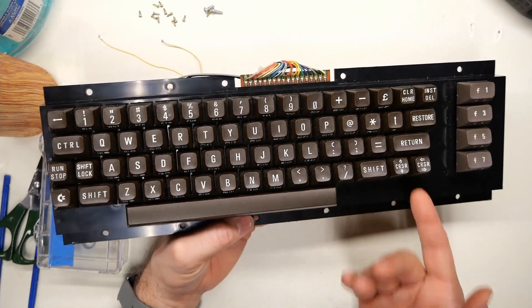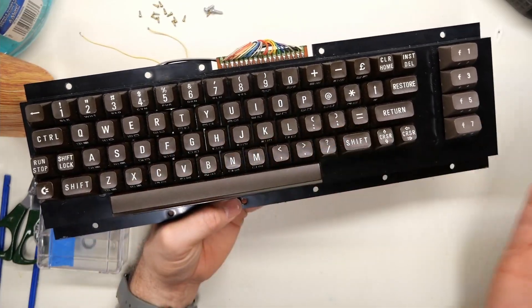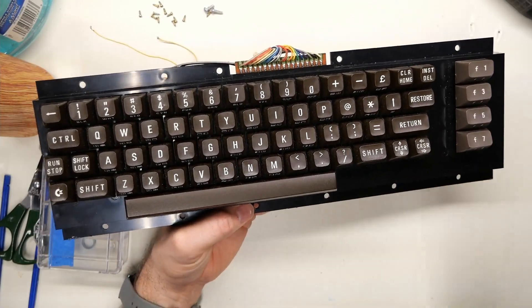There you have it — a completely different and unusual rubber dome bread bin Commodore keyboard. If anyone has seen this type of keyboard before, I'd love to hear about it in the comments below. Also, if you know where I can get a replacement rubber dome with the little contact pad in there, please let me know — I don't remember which computer I had that was missing one. It was more important to fix that other computer than have a working pound key on this keyboard, since other 64 keyboards with springs actually feel nicer to type on. If you like this video, a thumbs up would be appreciated — hit that subscribe button to the second channel and check out the first channel. A huge thanks to all my patrons for supporting Adrian's Digital Basement.